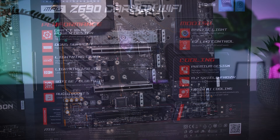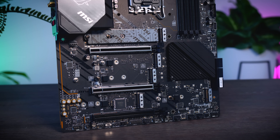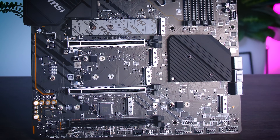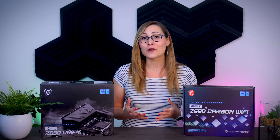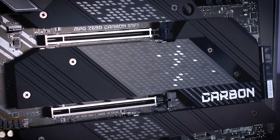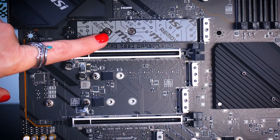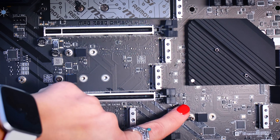The Carbon can fit a total of five M.2 SSDs on the board. Four of those M.2 slots support Gen 4 SSDs and the fifth is a Gen 3 slot. All five have cooling on top, but only the first one has cooling on the bottom — which generally isn't a big deal, because the controller that needs cooling usually sits on top. MSI added sliding latches instead of tiny screws to install the SSDs, but unfortunately only on three out of five slots, which is a bit odd. So if you want to use more than three SSDs, you'll still need to deal with those annoying little screws.